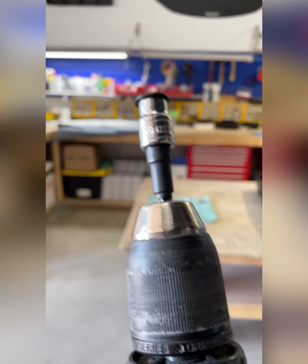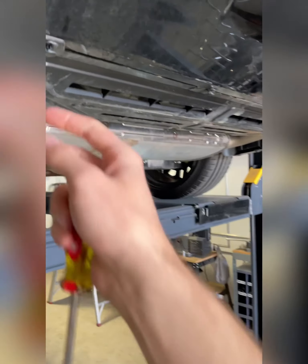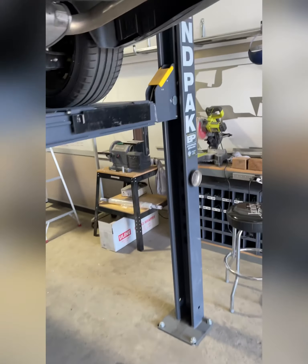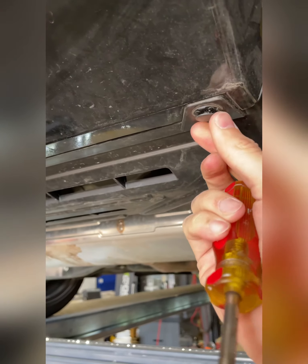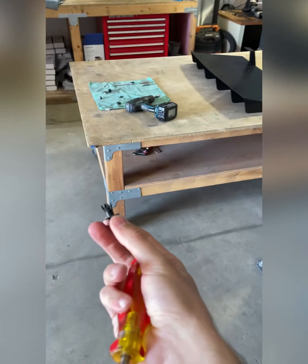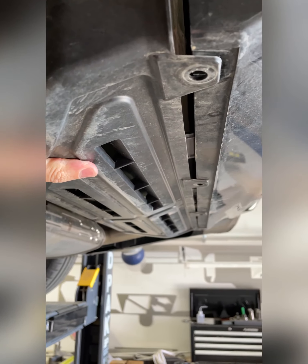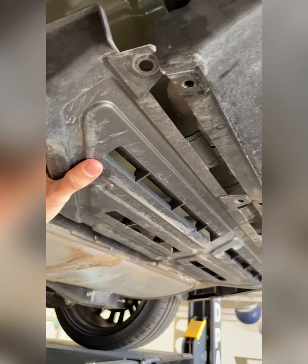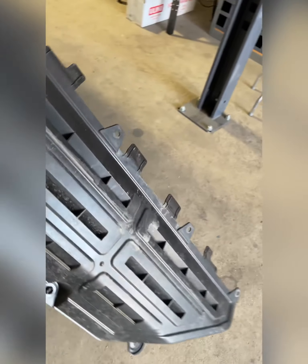After you get all four clips removed, you can get them all off — here's two, three, put them to the side, and four. Then grab the tray and pull it down. The center nut here is actually an 11 millimeter — you don't need to unscrew it, just grab it, pull the whole thing down, it pulls over that 11 millimeter nut and comes straight off. There are a lot of rocks up in there. So that's your first step: take this tray off.